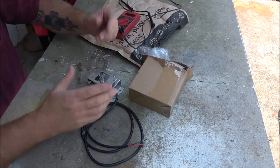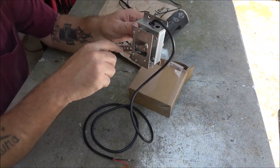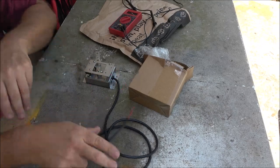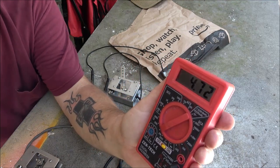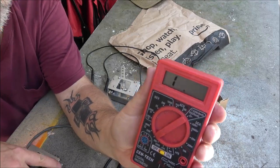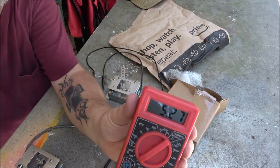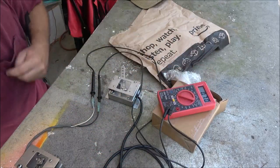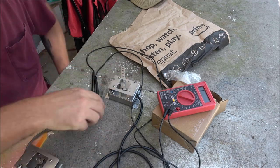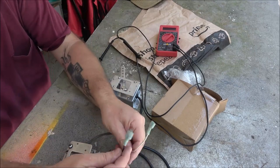Alright, I'm going to pull the old one off — I'll clean my lens too. I went through the removal in the other video, there'll be a link in the description box below. It's real simple — I think it's only two bolts that hold it on and then the throttle cable. We also need to swap the ends from the old pot box onto the new one. Now, as you can see, I'm not even touching this old pot box and it's just jumping around doing crazy stuff. If I move it like this it goes off scale — I had to set it to twenty thousand — so that's what it was doing, jumping all over the place.